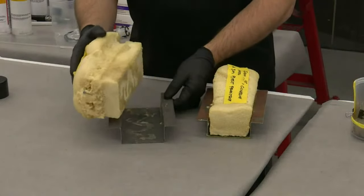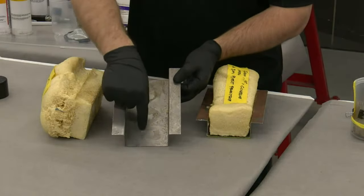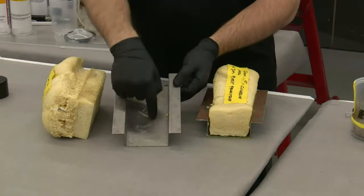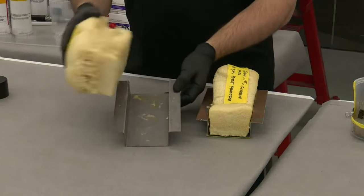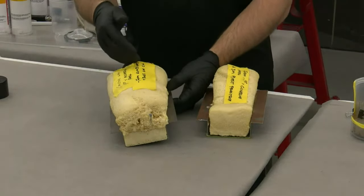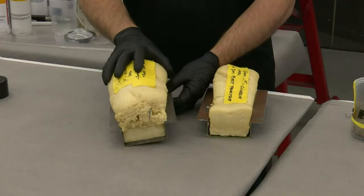And one of the reasons why that is because if we apply cavity wax first and the foam happens to break loose, it's because now we've prevented it from bonding to that substrate. You can see here on this panel, the only place that we got any type of bonding with the foam is directly where I put the mixing nozzle and applied it right into the wet cavity wax. The rest of it has broken completely clean. And why this is important is, imagine you didn't get it directly in there, because how often do you have direct access to apply these foams? And it expands and it doesn't have anything to bond to, and now it breaks loose, and now it's going to be rubbing inside that panel.